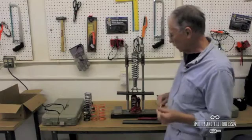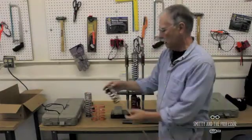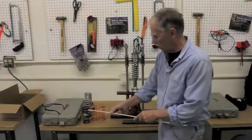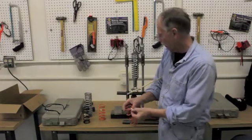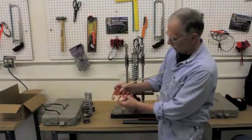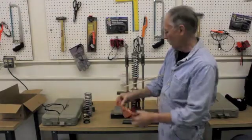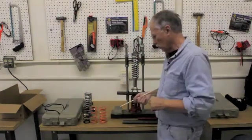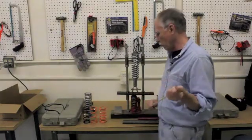We want to get the springs off because we need to change springs out in order to get the right spring rate. Here I have some springs — this little black one has '75 plus' written on it, so that's 75 pounds per inch of compression. Here's an orange one that's 120 and here is another orange one that's 180. In order to tune the car, you need to find exactly the right spring rate for the track conditions you'll be operating at.